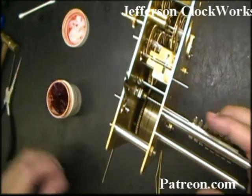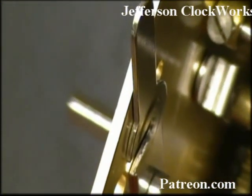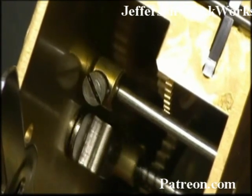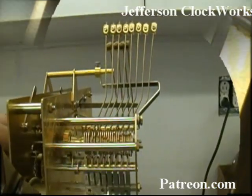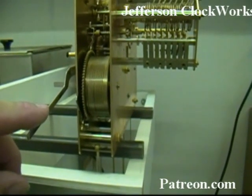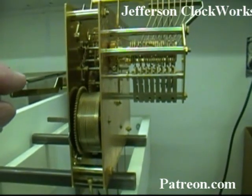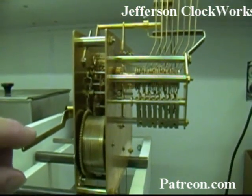The first area is that ratchet — we definitely want to put some grease on that. The Westminster chime position is all the way on the bottom on this particular movement, and it's four positions: Westminster on the bottom, then St. Michael's one click up, then Whittington, and then off. When you come out of off it'll probably start to go into chiming, but you don't really have to care about that — it'll self-synchronize.